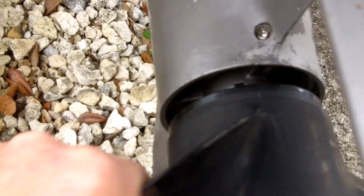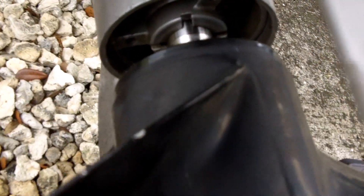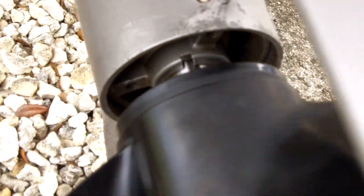Put some pressure in — careful, do not over-pressurize it. When you're doing it, rotate the prop a little bit. Right now the prop is not on, it's just sitting on there, but rotate the shaft some. Record your pressure. I set the little telltale arrow to about 10 pounds and it's holding. Pressure is good to go.